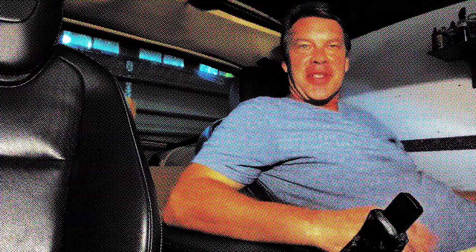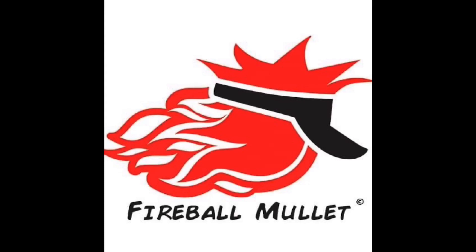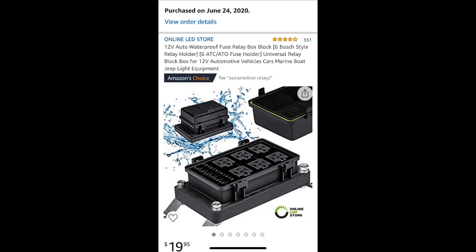I started overheating - it looks like a relay went out. Luckily I have a cool little switch I keep in the car and some extra relays. I also went ahead and bought a relay center because I just hate having relays bolted around the car's fenders. I think this relay went out because it was pretty close to the radiator, probably got hot and the coil started burning out.